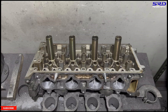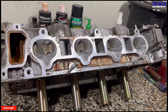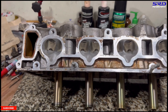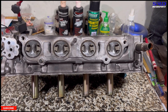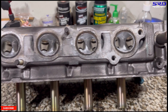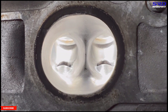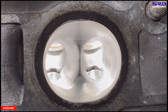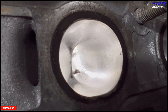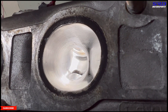After washing the head, here we are with the 120 grit finish — the head is all done. Instead of focusing on the intake right away, let's look at the exhaust. Here are the exhaust ports finished with 120 grit. You can see the ledge before the seat — we didn't touch it because removing it causes you to lose torque right away, so we maintain that. With better lighting you can see the exhaust port is really good now — it's going to be flowing really well, allowing spent gases to exit efficiently, generating more torque and increasing volumetric efficiency altogether.